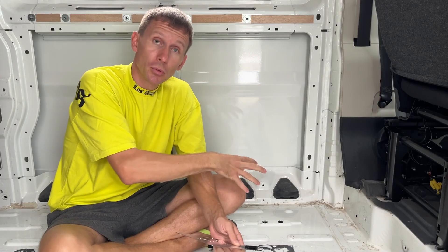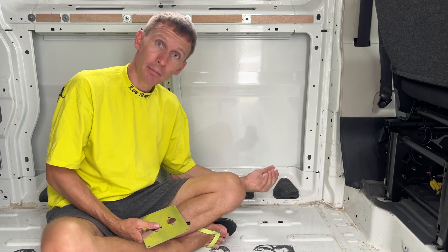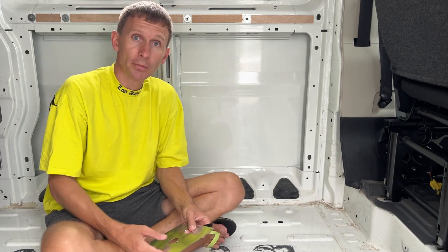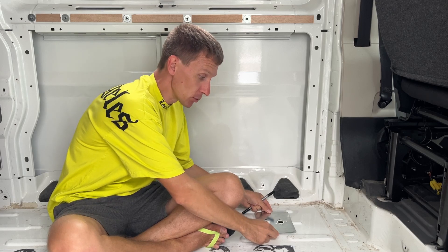Installing a diesel heater requires many holes. The installation will be challenging since we will need to connect tubes from below, which is tricky. So I'll connect everything to this plate, make one big hole here and install everything in it at once.